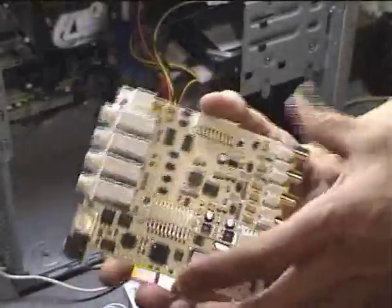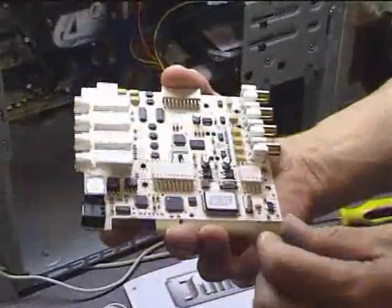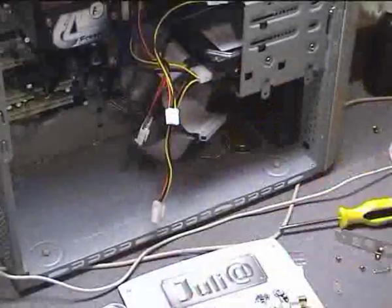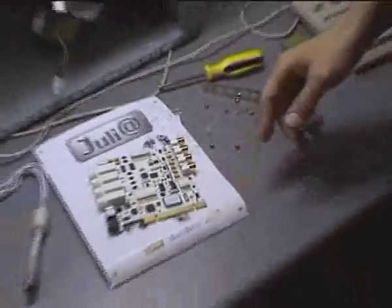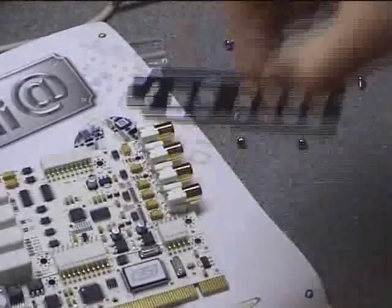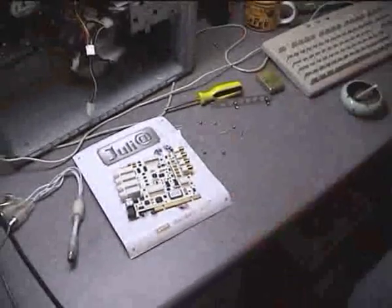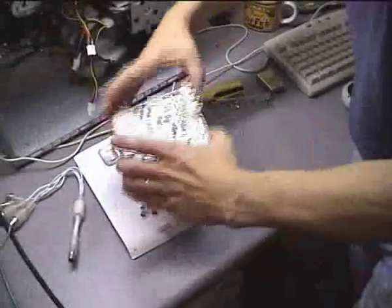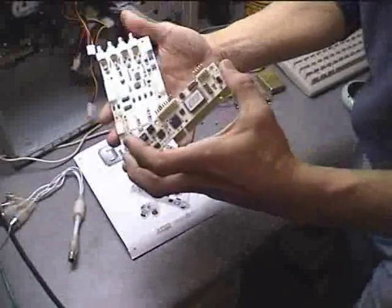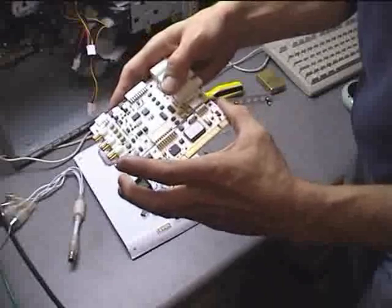That's pretty cool, huh? Then all you have to do is decide which you want, the minus 10 unbalanced RCA sockets or these quarter inch balanced plus four sockets, and then screw these little plates, just redirect the camera, and then all you've got to do is just screw these little plates back in to hold the card back together, and reattach the facing plate, and you've got a choice. And I think, given the entry price of the card, that is a really, really interesting touch, because you may be working in a multimedia studio situation where, you know, a pro situation where you only need stereo in and out, but you'd like balanced plus four level, and that's really useful.